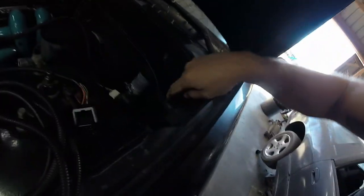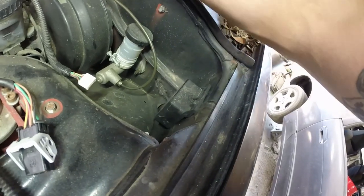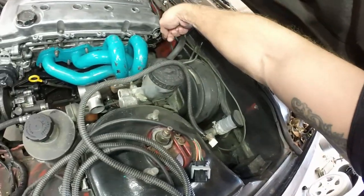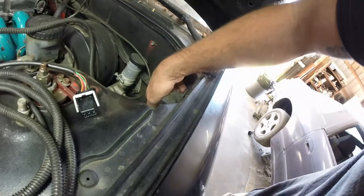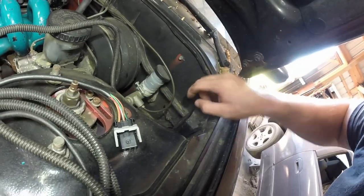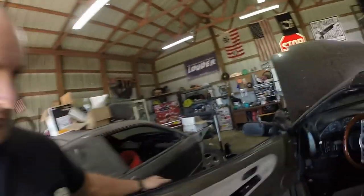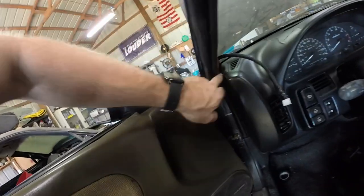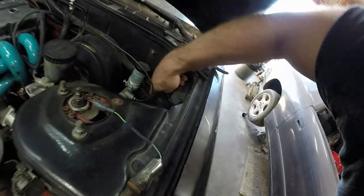Found a spot near the hood release to pass the wire through. I'll probably route it up top through everything, over the booster, and back down next to the transmission. I'm going to pull this grommet apart and shove the wire in. Quick look - I got it in there, I just have to close off the grommet because I had to cut it. I used a welding wire to fish it through the dash - it goes through without drilling any holes, which keeps it clean.